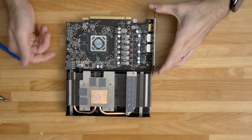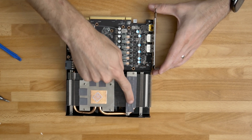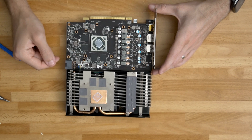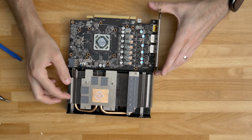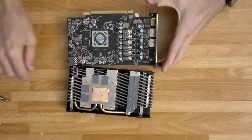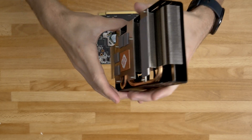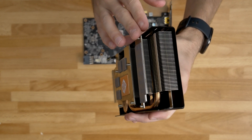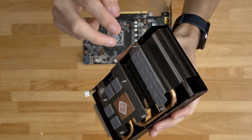This is actually excellent to see — the power delivery is actively cooled, connected with thermal pads that look to have pretty good contact based on the indent on the pad itself. There's a nice big thermal pad there, and then each of the four memory modules is also directly contacted with a thermal pad, hooking directly into the cold plate. There are two copper heat pipes on this cooler connecting all of this heat and pulling it out into the fin array. Below the VRM cooling there is just a fin stack, so the surface area isn't huge, but this is much better than no thermal pad and no contact whatsoever.